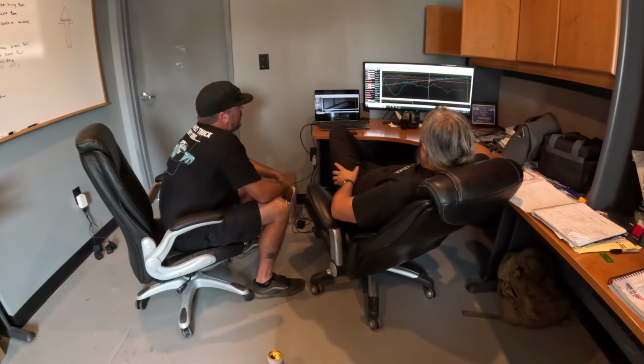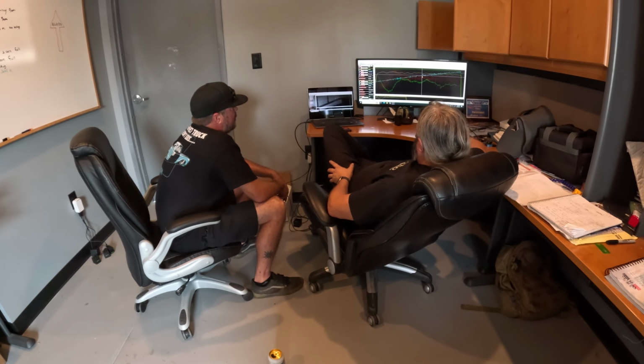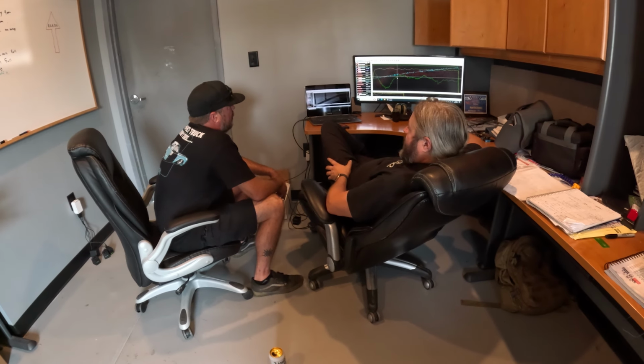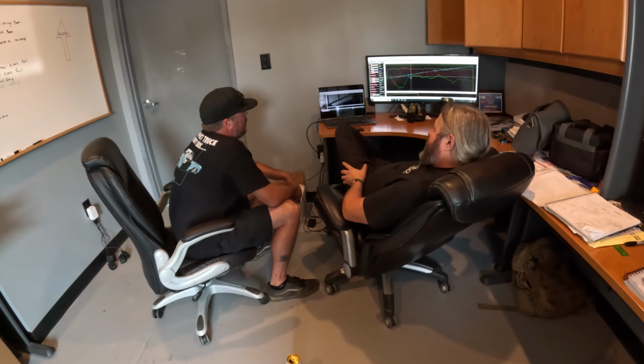I don't think there's anything wrong with the clutch. No, that just may be just how it is there. And that's at an RPM that you may not see except in low gear, because this is a diaphragm clutch, right?